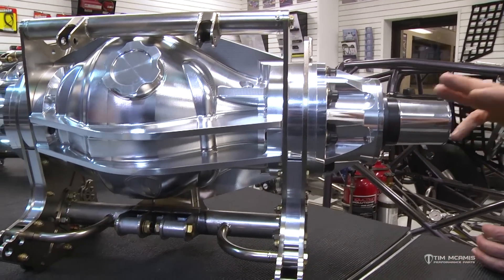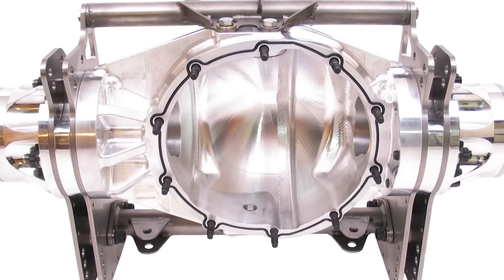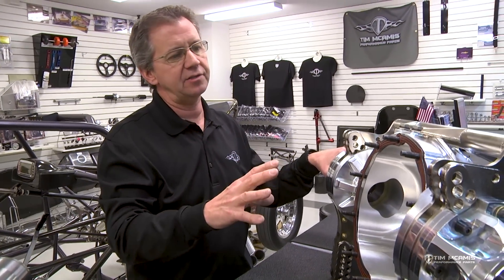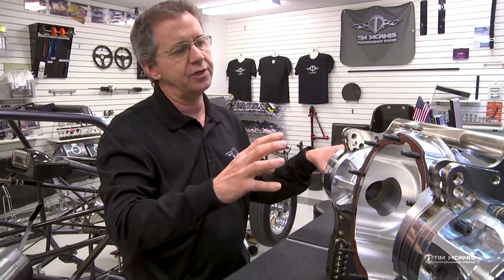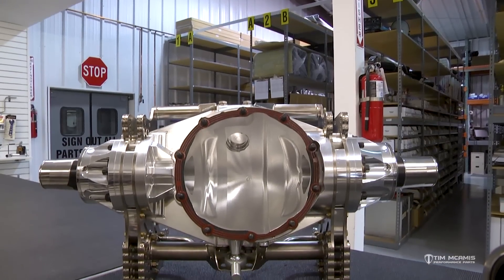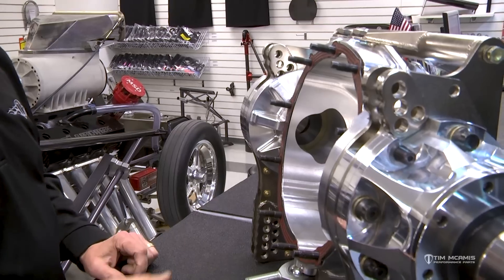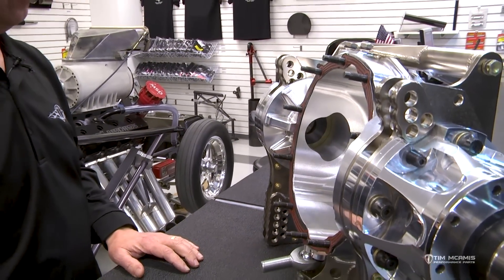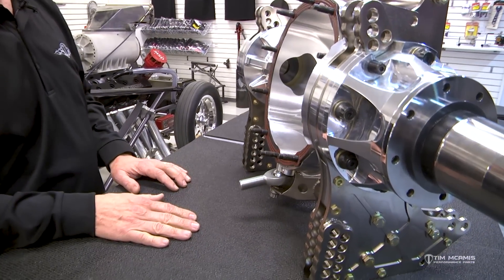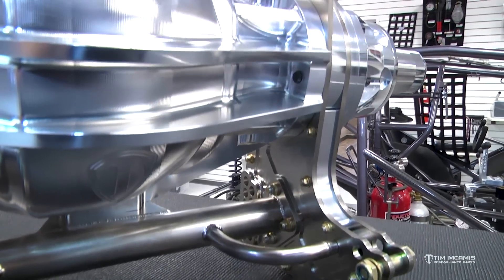We've also made a lot of changes to the housing design itself — lightened it up in some areas, strengthened it in others, and made some cosmetic changes. Originally we had an O-ring for the face gasket seal, but we found a lot of chafing where the third member would chafe on the face of the housing and get a harmonic vibration, kind of trying to weld itself together. So we went back to the impregnated gasket, which works really well. We also did feature changes to get the four-link closer together, redesigning a lot of the end bell components. This is a very nice housing ready to drop into a Bickle car.